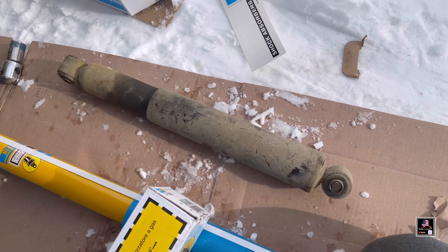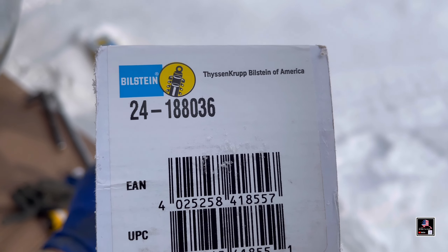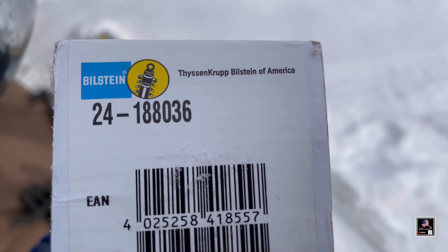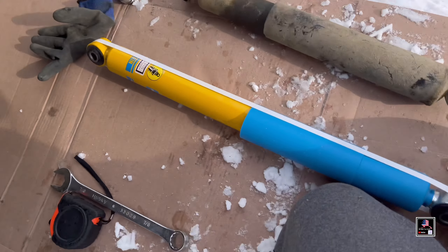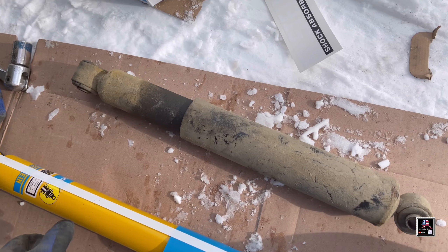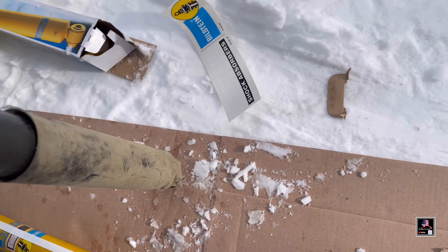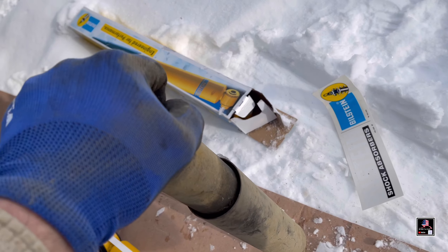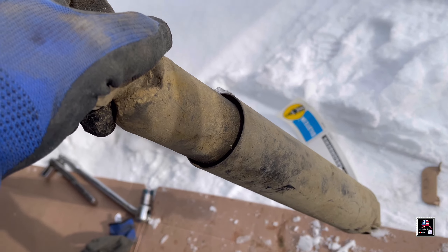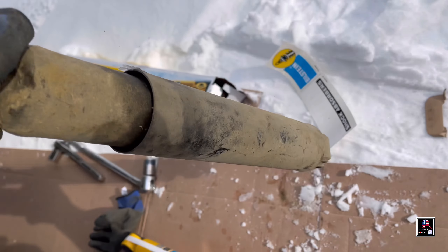Let's break it loose. Once you get the old one out — this one looks a lot longer because I just squeezed it in by hand. Here's the part number I'm using for the rear shocks. Here's what the new one looks like out of the box. I cannot compress this by hand, but the old one — I can compress it easily, and it's not even decompressing all the way — so it's definitely worn out.